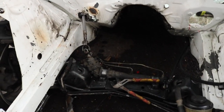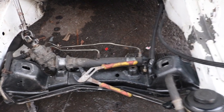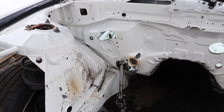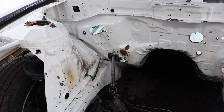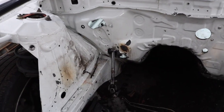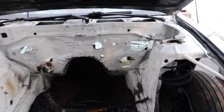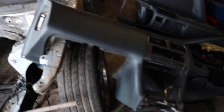We measured out where we needed to go, drilled the big hole through the firewall, put the carrier bearing in, bolted it up. We gotta chop this little triangle thing off and weld it to the other side or build another one. We also have to put a seat in here to get the steering wheel centered. We went to Ottawa and picked up a right-hand drive S14 steering rack — it seems like it's going to bolt right into the S14 subframe with no modification whatsoever. We'll also be blocking off the holes to do this swap properly. The other thing we picked up is a nice right-hand drive S14 dash in mint condition — it came with the center console, which is pretty rad.